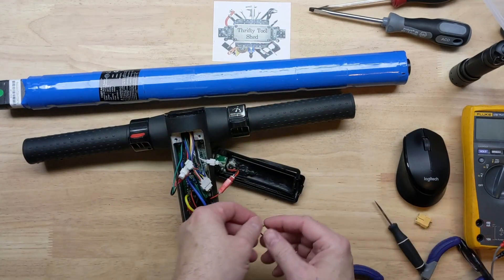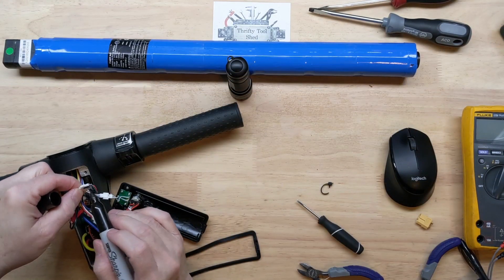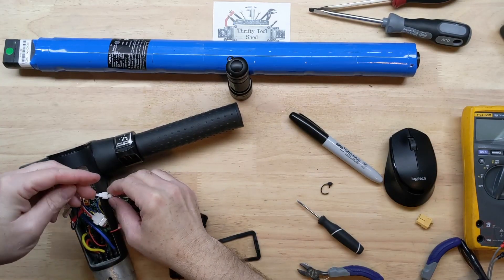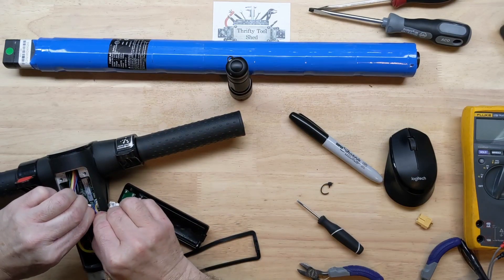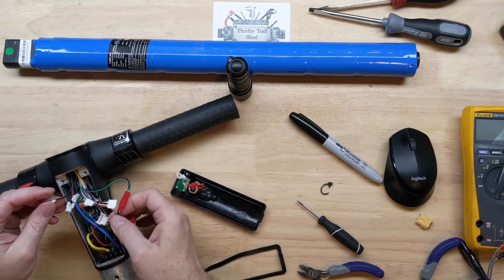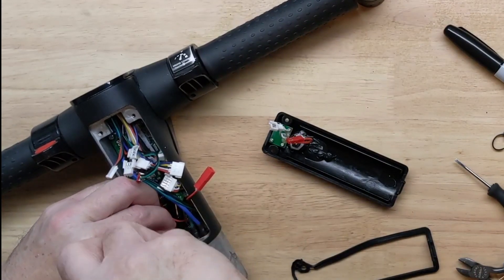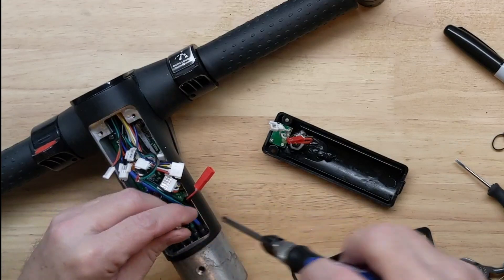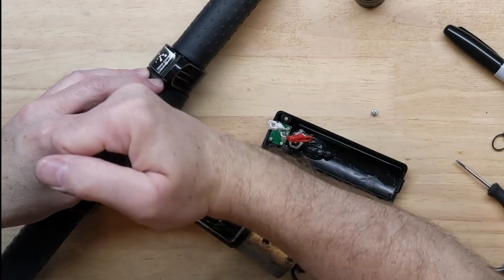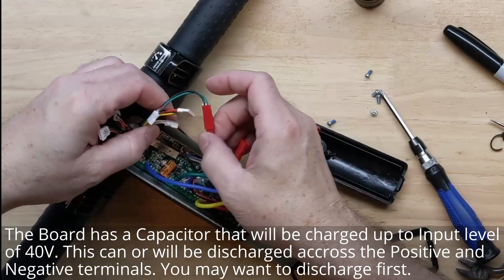Back on the bench I'm going to cut a tie wrap and look at these cables to see if anything obvious can be found without replacing the whole console. We're going to mark the connectors — even though I think these are mated where you can't really get them confused, I still mark some silver and some black since they look similar. This first screw seems to be on the connector itself. Remove this screw and we can lift the connector. It looks like we have at least four screws here on the board, so let's remove these four from the corners.